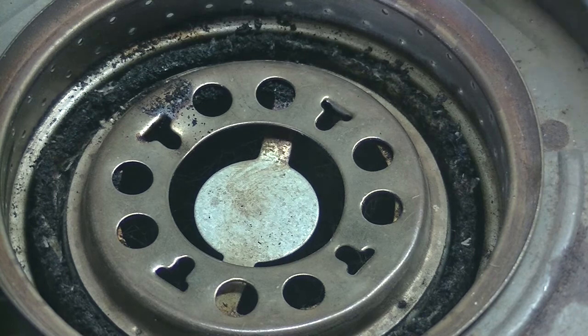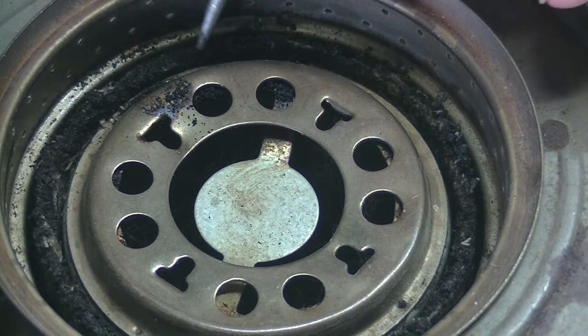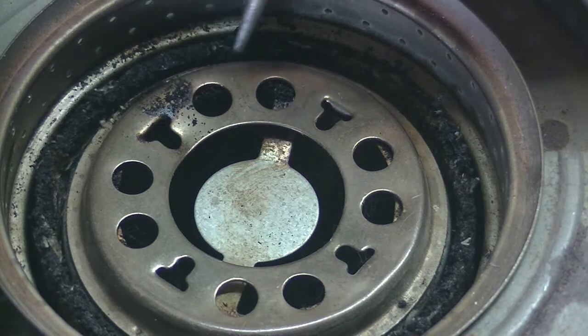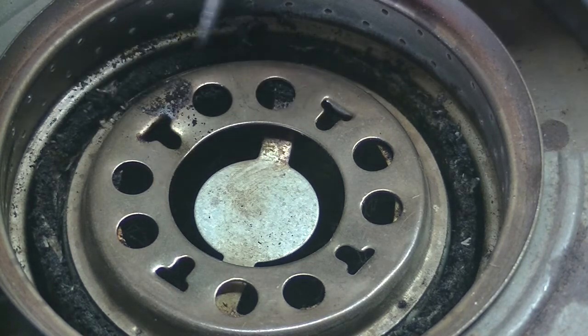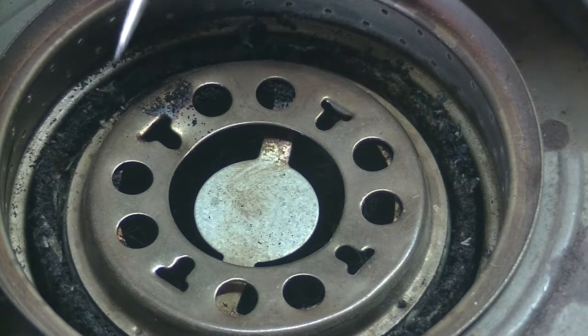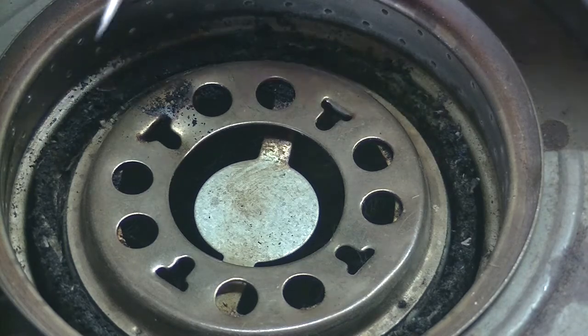Having a look at this wick, you can see how black it is. And right over there, if I get the screwdriver, you can actually probably hear it scraping. So all those little fibers are really clogged up. If I clean it, it's probably going to make the heater work a lot better and a lot faster.